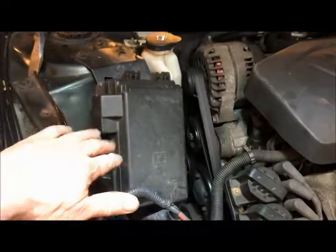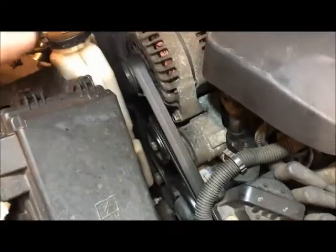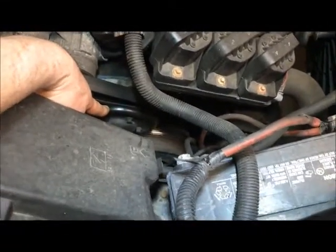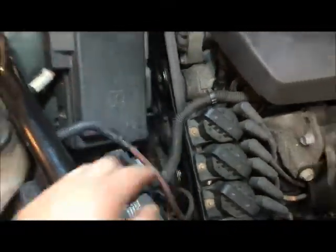To start, we will remove the fuse box and put it aside, then the reservoir for the coolant, and go ahead and take out the battery too. We will clear out all this area that we are going to work — the pump is down here, and it will be a lot easier if we remove things now. It's very tight space in there.